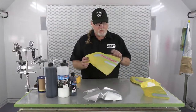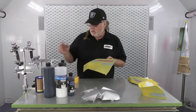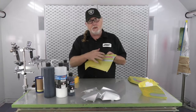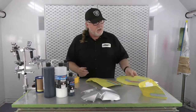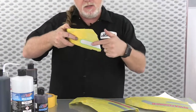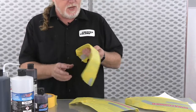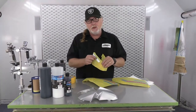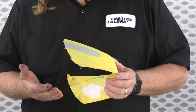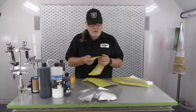We're back. I went ahead and laid the Spray Gunner logo on both panels and decided to do a little graphic around it. Artem wanted some orange so I got Grabber Orange Candy 2O. I did one with a mimic graphic below it, then the exact same thing on the other side. I did another on the back piece — a long graphic on one side and a short one on the other to emphasize the asymmetrical airbrushing I'll be doing with the biomechanical anyway. This is all masked up. I used FBS green eighth-inch tape, which is vinyl — when working water-based, use vinyl tape instead of crepe tape.